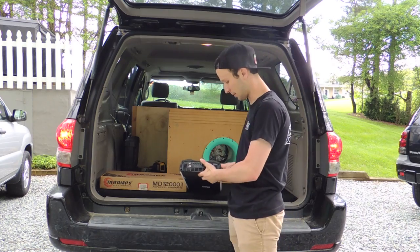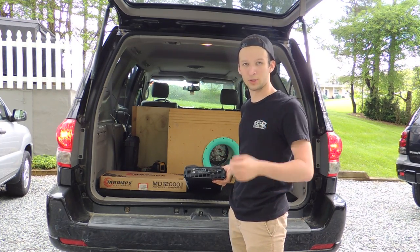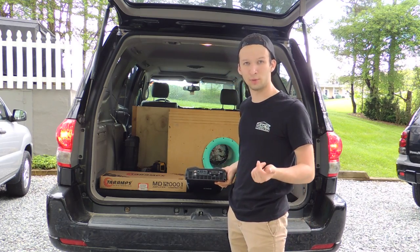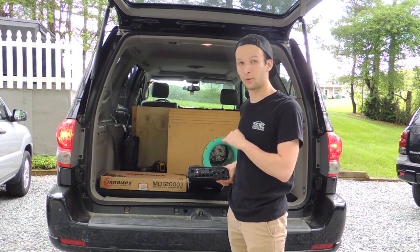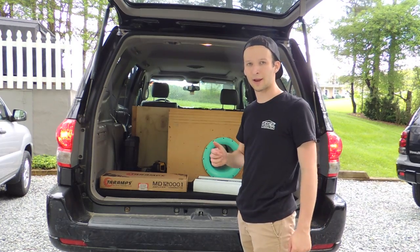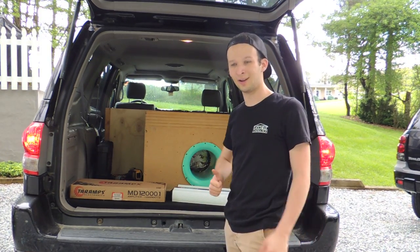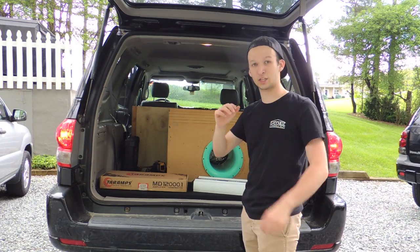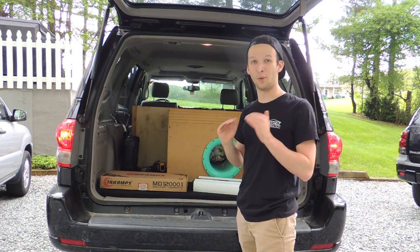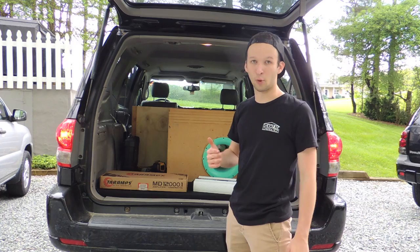So I just put in my third amp, and this was mainly my own problem. I had the car on and unplugged the two speaker leads from my box because I was going to plug them into another box — I wasn't playing music, but the car was on. The two leads shorted and that popped my amp. It went into protection mode, which is what it's supposed to do. I turned the car off for a few minutes and turned it back on — the amp went through protection, lit up blue, I thought we were good to go, and then it was pop pop pop bang — several sparks and a little bit of smoke, then back into protection. The built-in short protection on this amp was no good. Totally my fault for letting the leads touch, but it is supposed to be protected for that.